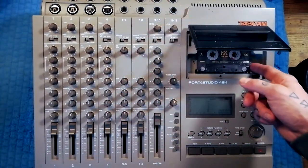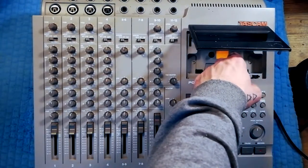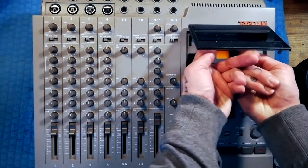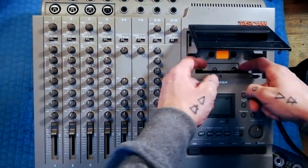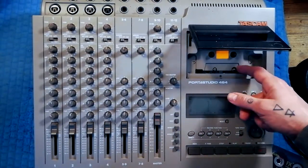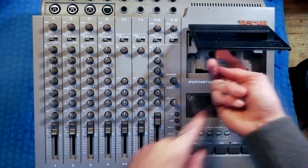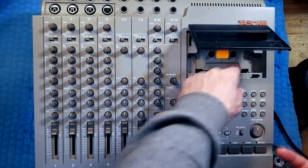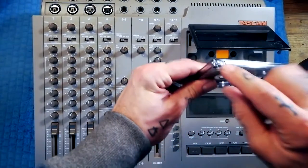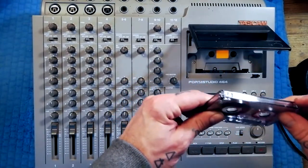I'll take this position-one ferric tape out. Not too keen on that. The capstan isn't turning. From memory, I think this is one of the models where it should be turning all the time. I'm feeling for a switch in there — I think that's just record enable or disable, depending whether you break this tab or not to stop it from recording over your amazing demo.